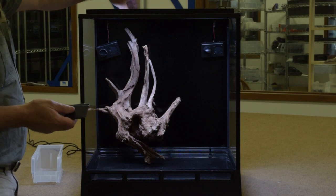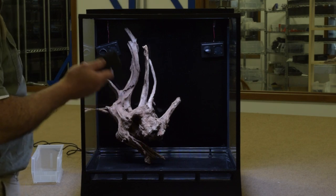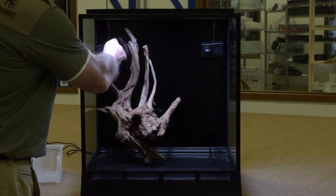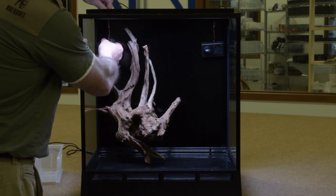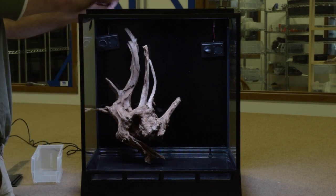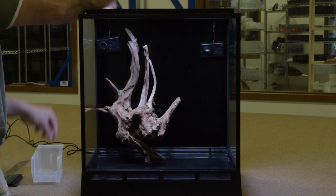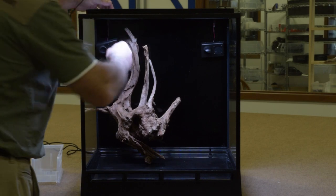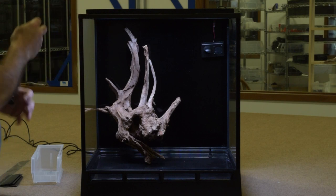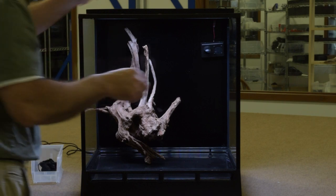We'll take off the back vent cover. And then, a little more delicately, we'll remove the fans because we don't want to damage them. We just pull up on the back cable, and that will release the fan. You take the strain relief, put it in a box, and then just feed the power cord down through it. And now we'll take the fan out for you. We'll save that in a box over here.